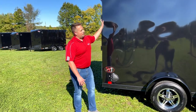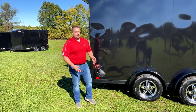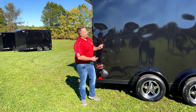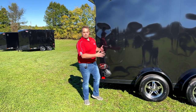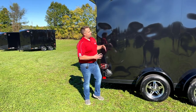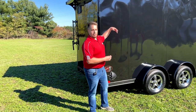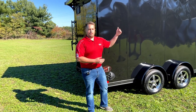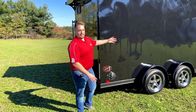If you take a look at the entire trailer, it's 100% screwless — this is our entire line. We're moving away from screws. We're not gluing — this is a 3M tape, and 3M will audit to make sure we're applying it correctly. The tube posts on the inside give us plenty of area to grip that tape to, giving us a nice strong stick so you don't have to worry about seams popping. Same with the roof: we have a new tape going across the roof bows, which are also tube. No more roof adhesive gooping down the sides — you're not going to have to worry about that anymore.